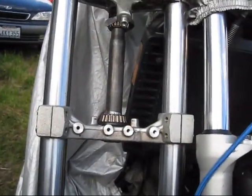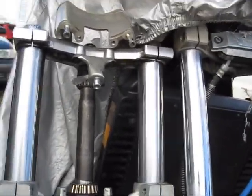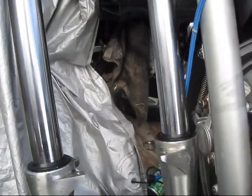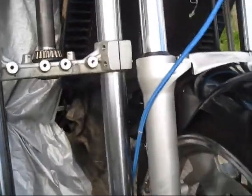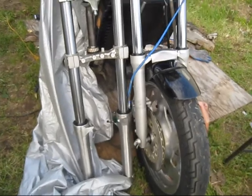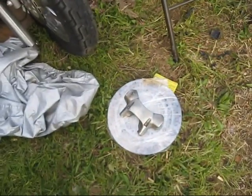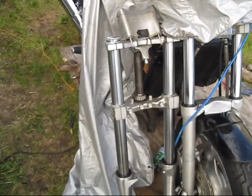There's a comparison. Plus these tubes have an air balancing chamber that goes in there, and this one doesn't have it. These are much heavier, newer fork tubes. I already had one of these things — I know they're really fast and that front end is not the best in the world. So before I even fool with it, I'm going to put on these big forks and big brakes. I've got a set of the right calipers, so I'll upgrade the steering on this to late model.